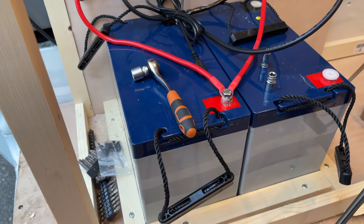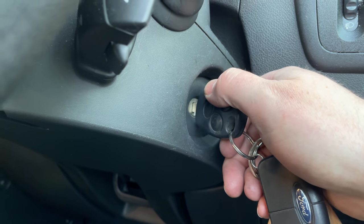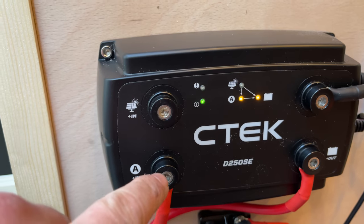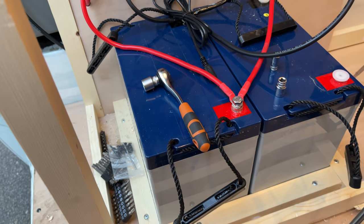The green light has stopped flashing. According to the manual, this means it's in current saving mode and nothing's being charged. If I start the van up, that should start charging the leisure battery. I've come back around and both lights have lit up — that means the alternator is now charging, which is awesome. I'll keep it running for five minutes just to make sure there's no smoldering wires.